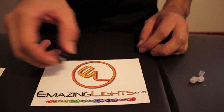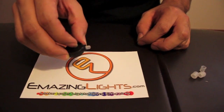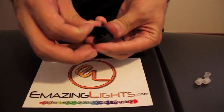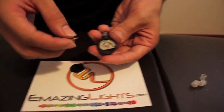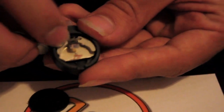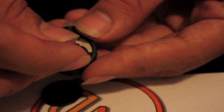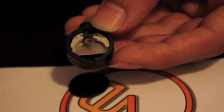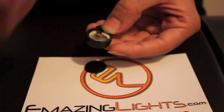I'm going to show you some hints on troubleshooting with a GloveMax. The main problem that people face with a GloveMax MicroLight is when changing batteries — you just take the door off and slip the batteries out. What people do is they accidentally bend this little arm. That's what makes contact between the chip and the batteries. When they're bringing the batteries out, they sometimes bend this arm up, so that when they reassemble their light, the arm isn't making contact with the battery, which leads to the light not turning on or staying on.